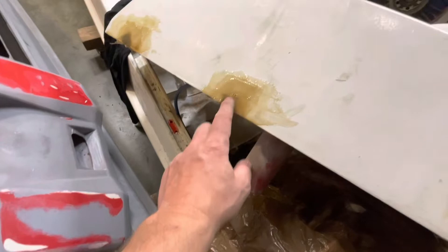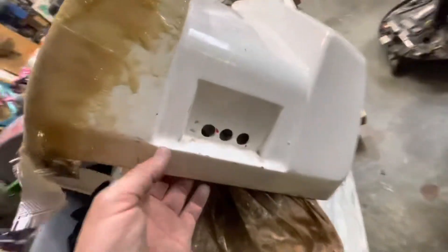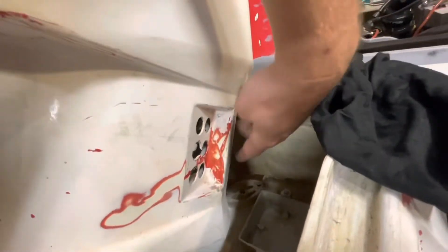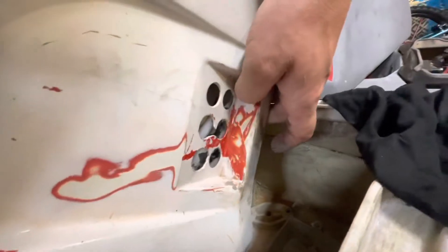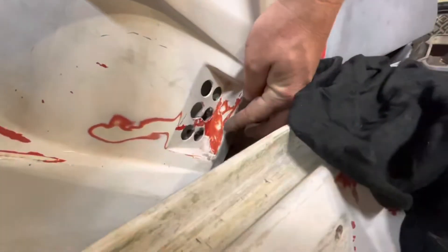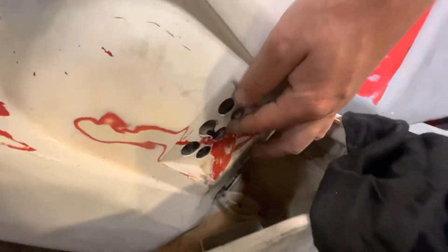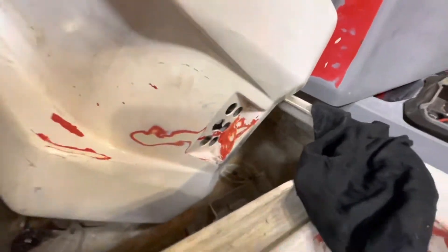I had a few little patches I wanted to make sure were good, so I put a few layers of fiberglass right here and right there. I do notice there's a spot right here that's cracked. You can tell it's been repaired here but there was no mat used, so I'm going to groove that all out and clean this up, remove that piece and make it nice and straight.